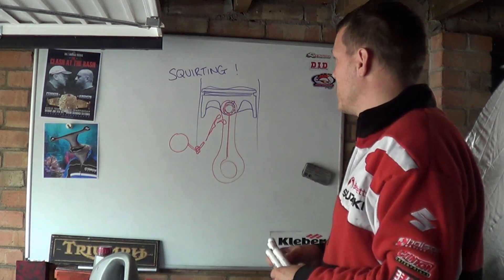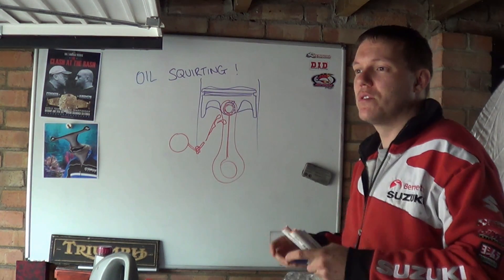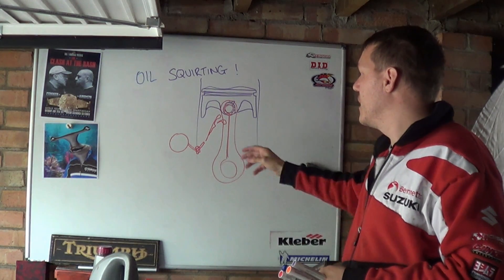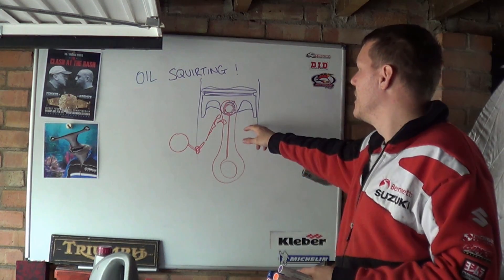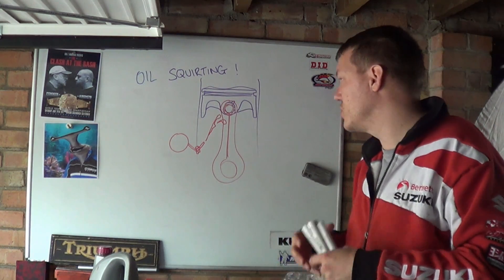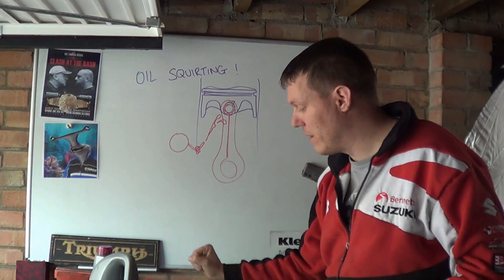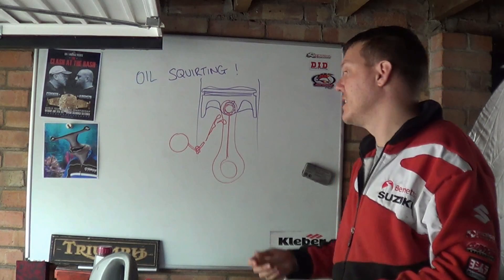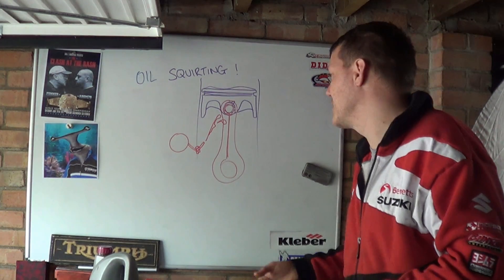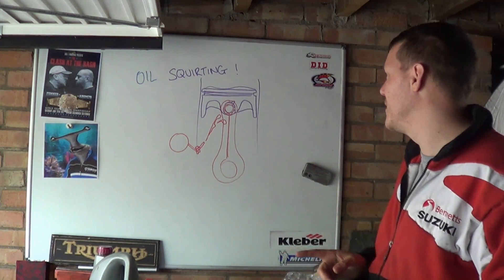But the main reason why oil squirting is used — just so we don't upset anyone — the main reason why we use oil squirting is actually to remove heat from your piston. You squirt the underside of your piston, and as soon as that oil makes contact with your piston, it absorbs the heat because it's generally cooler than the piston is. And then it falls off — as your piston comes down, when it stops, the oil still has momentum and it just flings off, and it basically rains down on your crank, which again is not a bad thing. But there are complications to this system, so that's why there's an entire video about it.